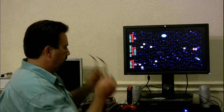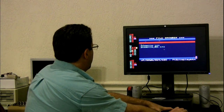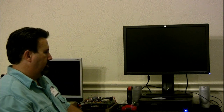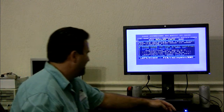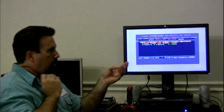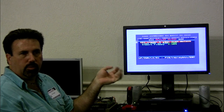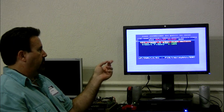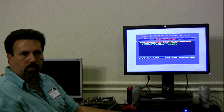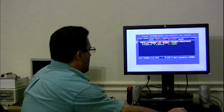With the C64 emulation, you can actually use any of the different types of SIDs. In the settings you can load D64s, load a program file directly into RAM. G64 support and flux image support are coming, so you can do copy-protected disks exactly like the original. There's a 1541 emulation that's cycle-exact to a real 1541 — similar to how the 1541 Ultimate 2 is, but it's built in, using image files off the card.